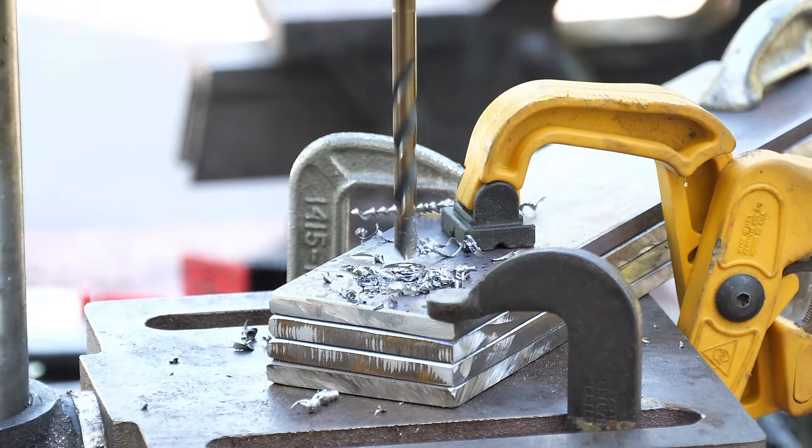Now, pretty much all we need is a brace to connect the pairs of links and make them nice and sturdy. We'll make sure to leave plenty of space on the leaf spring and body sides of the shackle, and from those measurements, it seems like two 5 inch by 3 1/4 inch plates will be just the right size. And with those trimmed down, we'll give all of our plates a once over with the flap disc so that they're ready to be welded once we have them assembled.